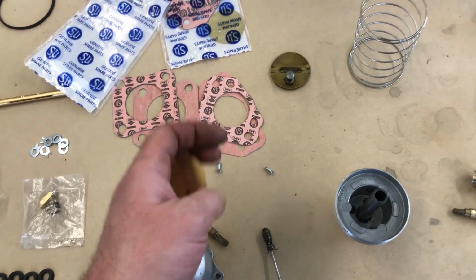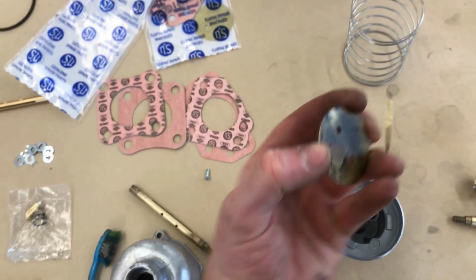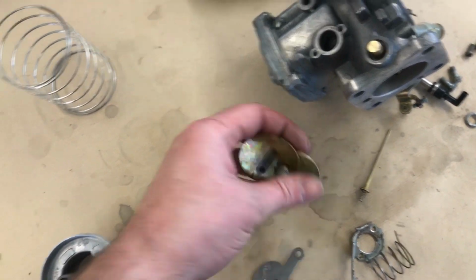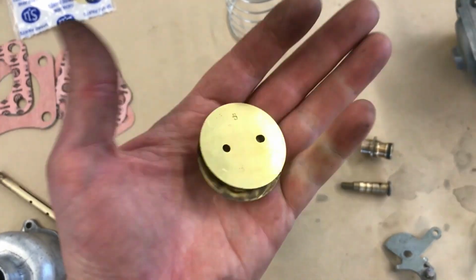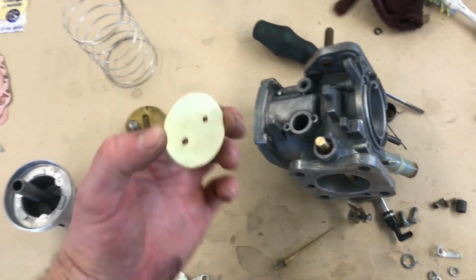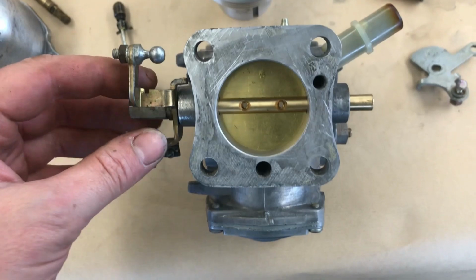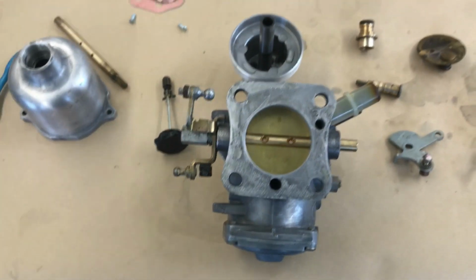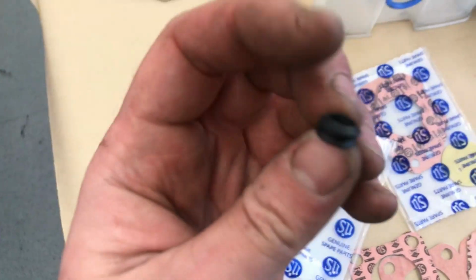Those are the screws. One thing I'm not super happy with is the disc is not exactly the same size as the other one. It's actually a tad smaller. So I'm going to fit it on the spindle and see what it looks like. But at the minute, it doesn't look great. Needn't have worried. Fits perfect. Closes up nice. No air gaps. I just need to take it back out and then fit my new lip seals.